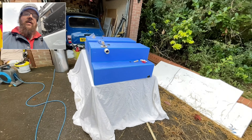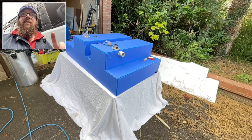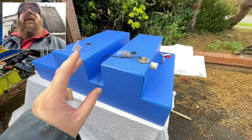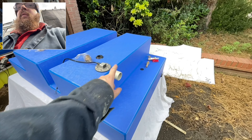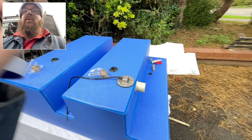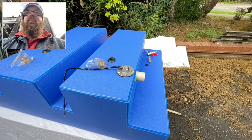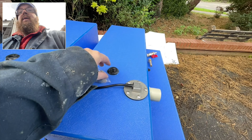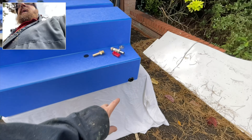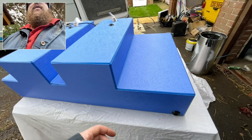This is the new tank. The tank is made of high-grade, water-safe plastic and it's all been welded inside and out - you can see it's been built to fit around the structure we've got there. I've got a 14mm spigot here for my inlet, I've got my gauge which I've gone for a better one this time with more stems so it doesn't just drop from 27% down to 17% - this should be more gradual. On the top I'm going to need to fit a vent here and here because of the two little compartments. Down here I've got my drain and over here I have my outlet, and they're all half-inch fittings.